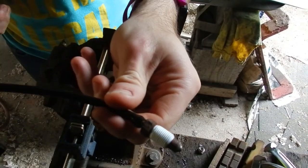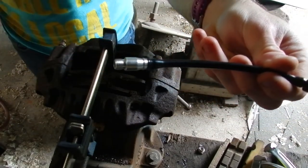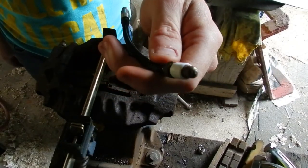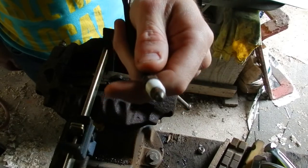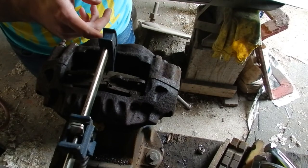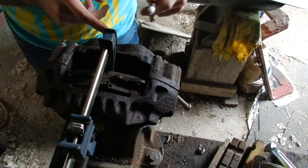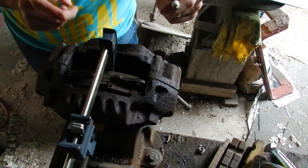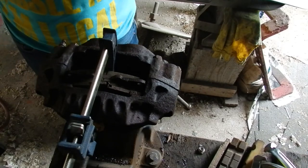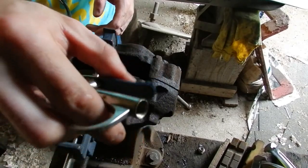I had a bit of a think, and here's what I've come up with: a fitting for the air gun blower, and the bleeder valve off the other brake. I'll put this bleeder valve in but not cranked all the way down so air can still pass through, then block off this port for the brake line. That should let me hold pressure on it while I give it some taps with a hammer and hopefully get things to cooperate.